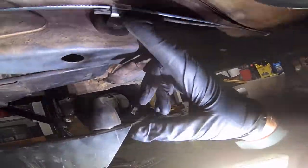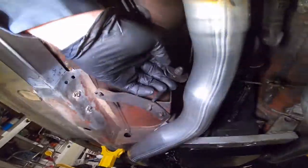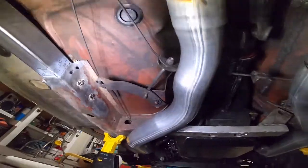And then I went to Ace Hardware and I got some of these cable couplers. You slide them in and then you bang on them with a hammer. I got one here and one up here. I pulled the cable from the vehicle tight, measured everything out, cut the 95 cable to where I needed it, cut the 67 to where I needed it, and you want to loosen this adjustment almost all the way off so that you can always tighten it back up. In case you didn't get it tight enough, you can tighten it here and it'll still work well.